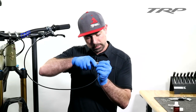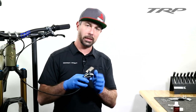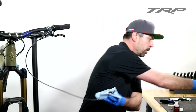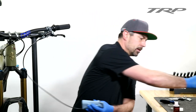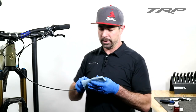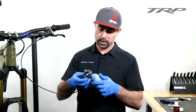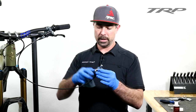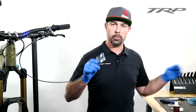Once the caliper is feeling nice and good, we're going to clean out the excess isopropyl alcohol from the caliper. Using a rag and the spray bottle of isopropyl alcohol, spray inside the caliper and clean all that excess mineral oil. My pistons are all the way pushed back into the housings now, so I'm not getting alcohol inside them or on the seals. You can even floss the caliper to get that excess mineral oil out. Now this is all cleaned up and it's ready to be put back on the bike, pads installed, and you'll be ready to ride with a fresh feeling brake.